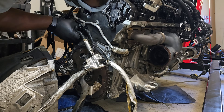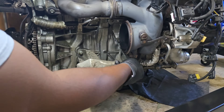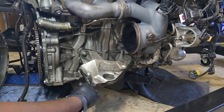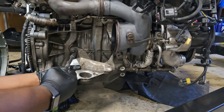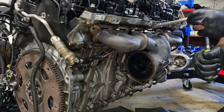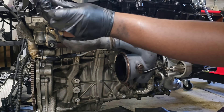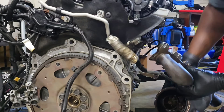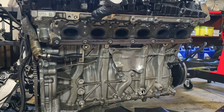Now it's time to swap everything over. The first thing I pulled is this power cable that I noticed was different than the one on the 740 engine — this was just a sign of things to come. Next, remove the engine support bracket that attaches the engine to the engine mount — it should be four E-Torx bolts. This was also different because the G-series subframe on a 5-series or 7-series is different than the ones in an F-series, so the engine supports for the engine mount were different as well. Next, I pulled the turbo itself. If you bought an engine with a turbo it should be the same, but in my case I have a turbo upgrade, so I definitely wanted to swap the turbo over to the new engine. Pull all of the lines and the turbo support bracket underneath the turbo and all the nuts on top of the top mounting rail, then pull the turbo itself and remove the last two screws holding the engine support bracket onto the block. I also had to remove the studs that the turbo mounts on because the engine I bought didn't come with them.